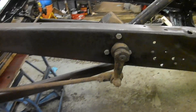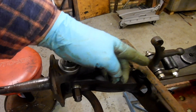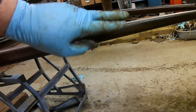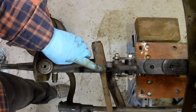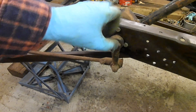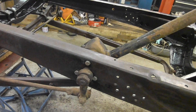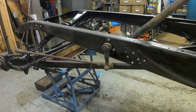That's why it's important that you have the right one. For instance, if you fitted 37 spindles with one of them wishbone slingshot steering arms — it's central — your drag link is like an inch too long. This is what I was saying about maintaining the 90 degrees: you've got 90 degrees there and when you look from above you've got 90 degrees there, within a degree or two. When you fit one of them other ones, it puts your steering box off the sweet spot when you're at the straight-ahead. There's a sweet spot on the steering where all the free play is adjusted out, and you want the straight-ahead on the sweet spot. The Ford engineers did their homework to come up with that length.